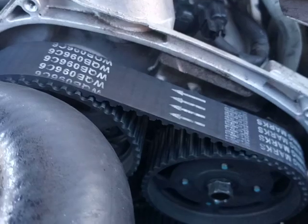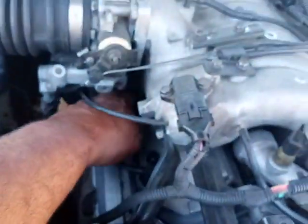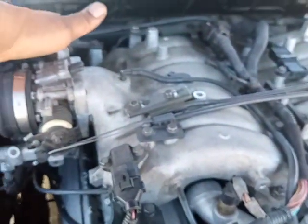They said that timing was replaced, but the bad thing about it is he said that everything was functioning and everything was working. And when he did the spark plugs, this is when all the problems started. He got new coils, so what are the chances of all 3 coils being bad? That's 1, 3, and 6.